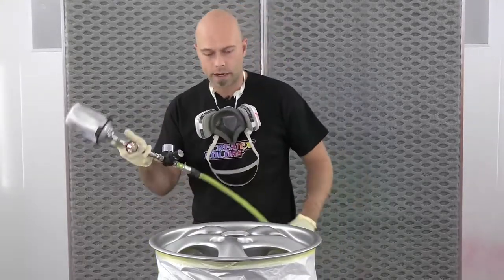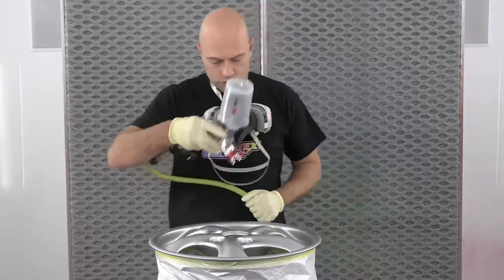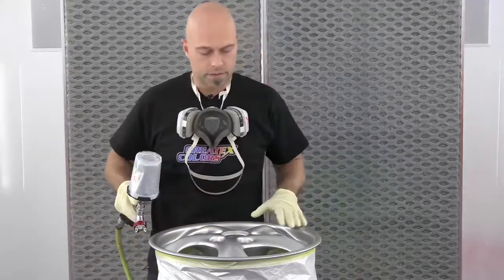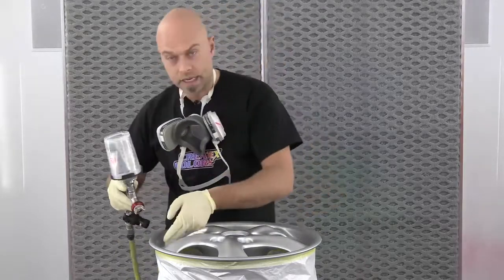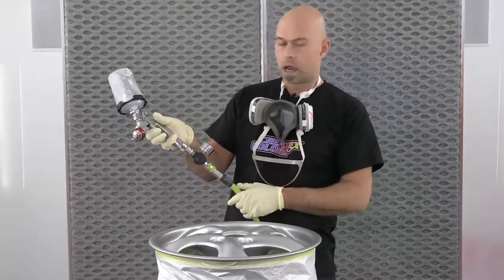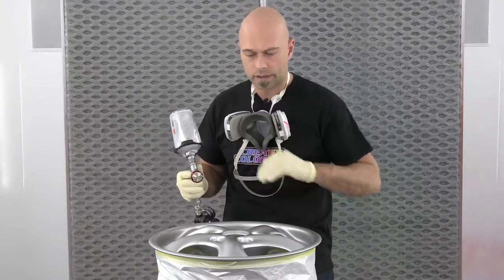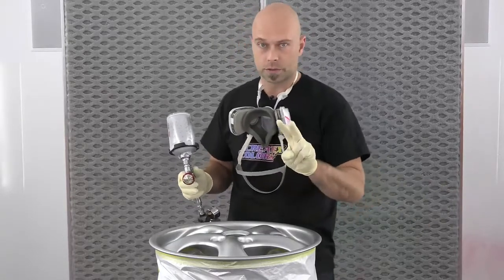The way I was spraying looks a little haphazard but it's just an approach to feather in the lips. We have a lot of different areas and I just want that wet overlap. The first coat was to get everything nice and even; the second coat is just to make sure I didn't miss anything because we do have all these edges. I'm going to apply it the exact same way — right around 18 PSI on my regulator. A nice even coat, not too wet — we want a medium wet coat of sealer. We're going to let this dry and then come back and do our effect coat with our Cosmic Sparkle Silver.